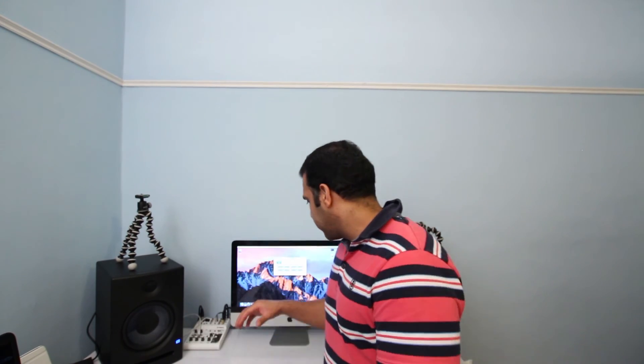Hope you have liked this video about upgrading the RAM on the mid-2011 iMac. I'll leave all the specification and model numbers in the description. The maximum RAM you can run on this specific model is 32GB, and installing 8GB in one slot proves it can actually go up to 32GB.